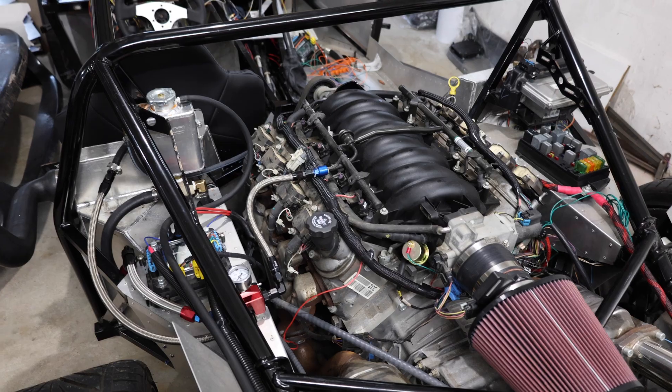To check the injectors on the car, you need to know how the injector system works. On some cars you could have a positive switch to injector; some cars a negative switch to injector. On the LS1 behind me, there's always going to be 12 volts at the injector plug. When it's functioning, the computer is taking the switch and bringing it to ground — it's not turning 12 volts on and off, it's actually switching the ground. So it's a ground switching circuit. Understanding how the test lamp works, since we're checking for a ground switching on and off, the other side of the test lamp has to be connected to a positive 12 volts. We're going to connect the test lamp to the positive 12 volts on the fuse box, turn over the engine, and watch to see if the injector is firing.